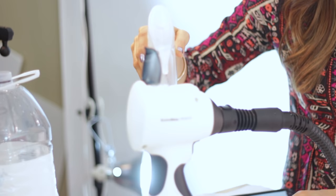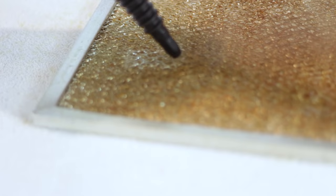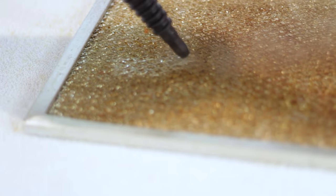There are a couple of other methods you can try. First of all, if you have a steam cleaner, feel free to lay a towel down, put the grates on top, and then blast steam directly onto the filter. You'll see that the grease literally falls off and directly onto the towel. It is a little bit messy and a little bit gross, but it is very effective.